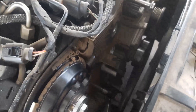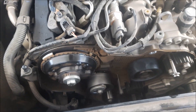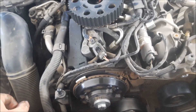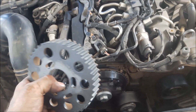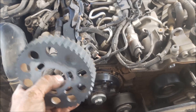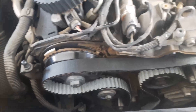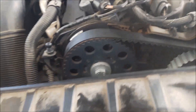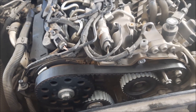Now I am going to install the bolts, then install the rollers, and then install the timing belt. Because the timing belt is new it is going to be more difficult to install with the camshaft sprocket already installed on the camshaft, so I am going to install the timing belt first, then put the camshaft sprocket on. I have put the camshaft sprocket. Next I am going to install the last idler pulley, and after that I can adjust the tensioner.